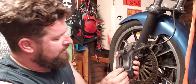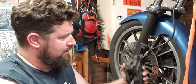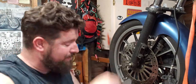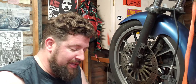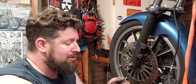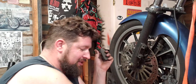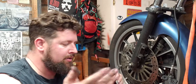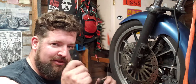Push it all the way back. From there, take your screwdriver and pop the pads out. Now, in case anybody was wondering how you know if your pads are bad: the general rule for most brake pads, according to EBC, is the minimum thickness is 40 thousandths of an inch. A dime is 50 thousandths of an inch. So if you can get a dime in between the rotor and the backing plate down inside the caliper, they're considered still good. Once the dime doesn't fit, it's time to start thinking about replacement. These Brembo calipers do have a little bit thinner of a pad, so they're already going to start out a little bit thinner. You might want to err on the side of a little extra caution, but don't push too far on your front brakes — don't screw around.